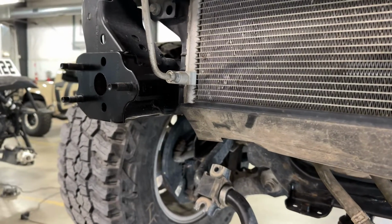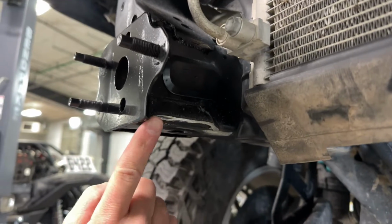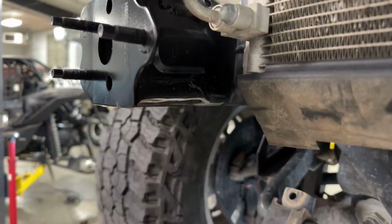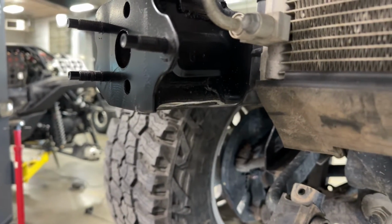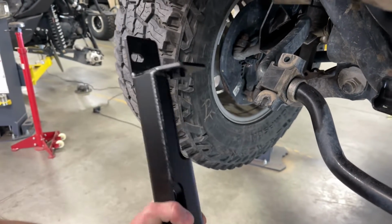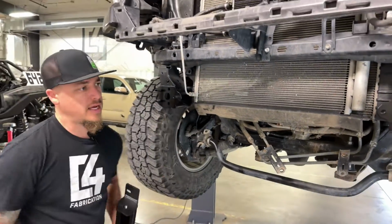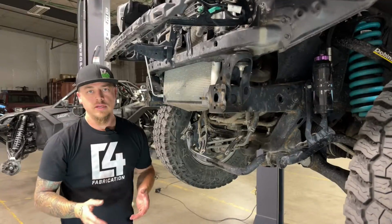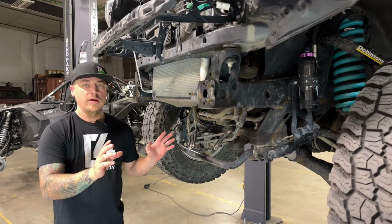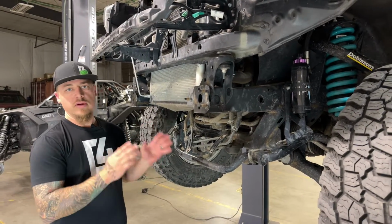And as you're sanding off the bottom of the frame here and cleaning up these welds, you want to make sure that you bevel this one piece of steel here that's left on the frame. That's going to make room, just clearance for this weld that's on our cross member that we need to put up in there. So you want to make sure that those are beveled on both sides. Now we just need to go ahead and spray some black paint on there so everything is sealed up. And once that dries, then we can proceed with the rest of the install.